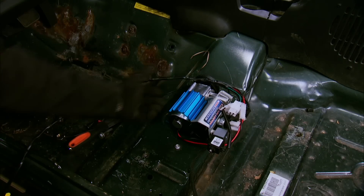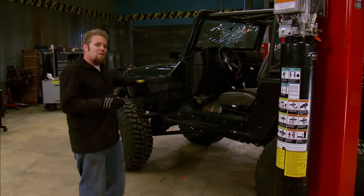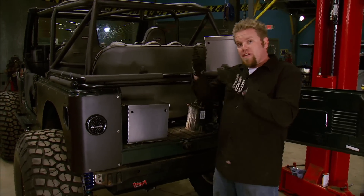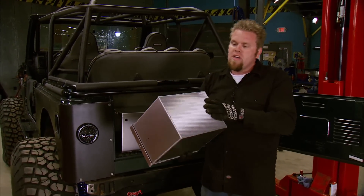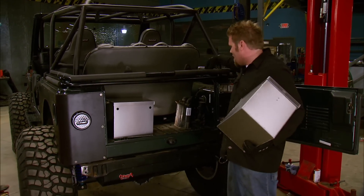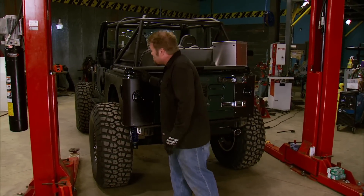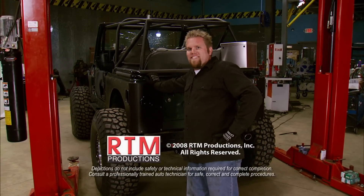At this point in a Jeep build, you've basically run out of room for everything — and that's the case for our battery. The only logical place to mount it is behind the back seat. You don't want to just throw the battery in there with a ratchet strap — if you short out across the posts, the battery can explode. The best thing to do is use a battery box. We picked up two aluminum Summit Racing battery relocation kits: one to mount the battery in, and another to cover up the natural vacuum leak detector we moved from the other fender well. This Jeep has made a huge transformation from an insurance write-off we basically dragged in here for free. Next time we have this Jeep in the shop, we'll button up what's left — and then we'll hit the trail. And we'll hit it hard.